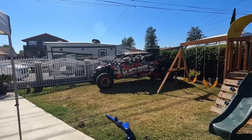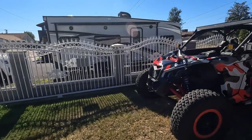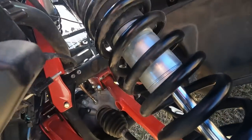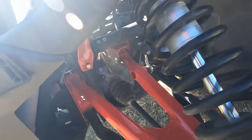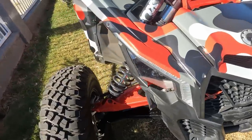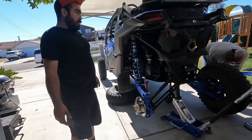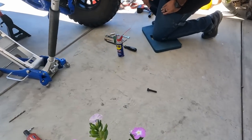The 'me machine' has a little issue unrelated to this HDR install — the front diff has developed a leak. I think it's the O-ring on the side cover because it's on the bottom, not coming from the side seals or the pinion seal toward the back. So we're gonna have to pull the diff, reseal it, and throw it back in if it's not cracked.